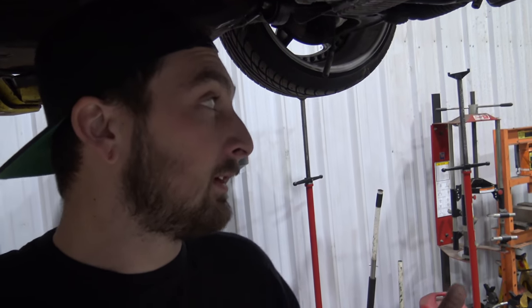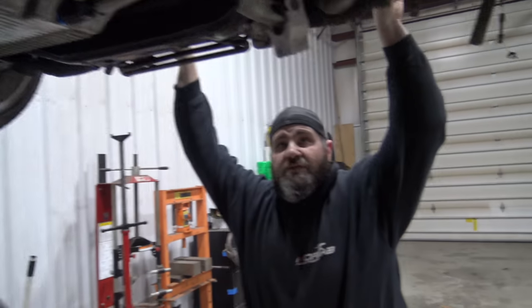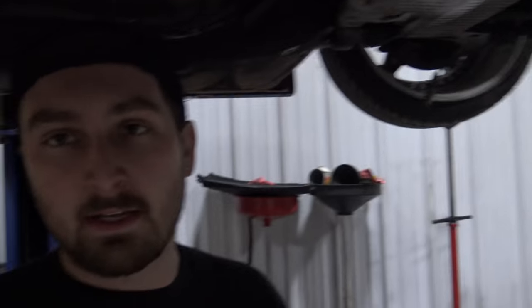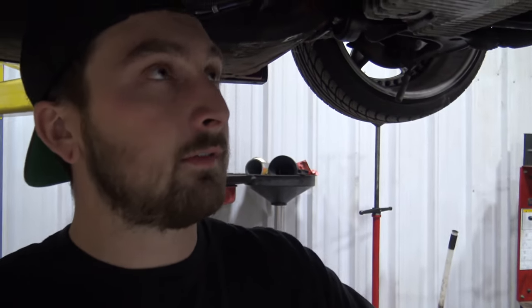That's how you make a right-hand drive turbo BMW downpipe in the most ridiculous artistic form ever. Justin did the pie cuts because he had them and because he's crazy like that and likes to do cool stuff. Even if you just used 90-degree bends, one or two pie cuts probably would have got you what you needed, but I wanted this one to be completely perfect fitting - and it came out amazing. I don't want anyone to feel deterred - this is definitely possible. Buy yourself an eBay manifold and you can make it fit. From here we can just do a typical BMW three-inch cat-back.